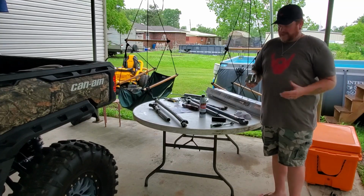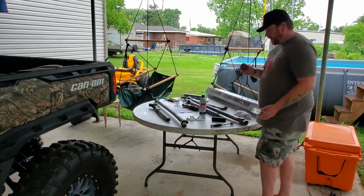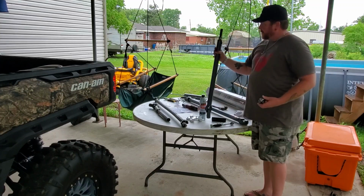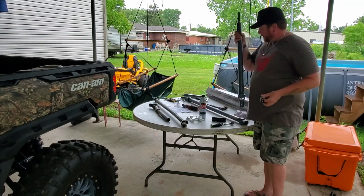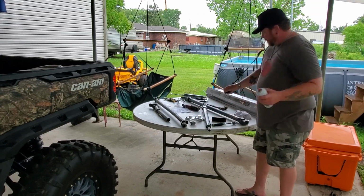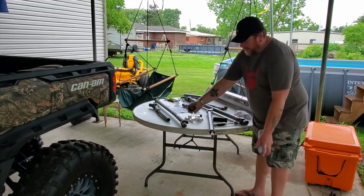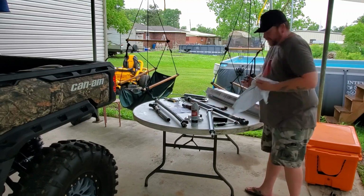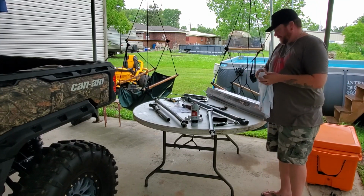Our carrier bearing comes pre-assembled, with 4 Allen head screws. We're simply gonna take those out and we can get our hands on the bearing. Now the rear drive shaft is the shorter one. What we're gonna wanna do is clean up this shaft and drive this bearing onto the shaft. So the first thing we're gonna do is I've got some carb cleaner. We're just gonna spray down this bare metal surface and on the inside of the bearing as well. And we're just gonna get that as clean as we can, get any grease or any foreign materials out of it that we can.